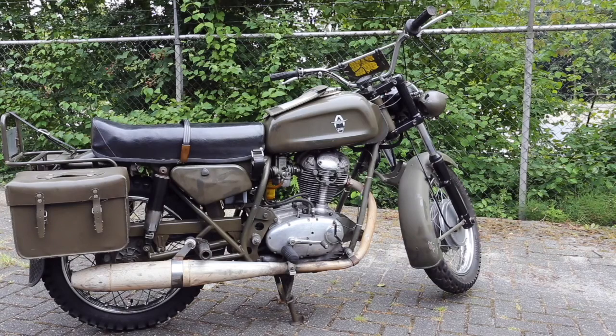Very typical of the Condor is the cam — it's a very mild cam. One thing people do to give it more power is replace it with a scrambler cam, a green-white scrambler cam. Together with the exhaust upgrade and the cam, it will up the power from about 16 or 17 brake horsepower up to about 19 or 20. I've had quite a few of these bikes, and one thing everybody wants is a reliable top speed — if you happen to be on a highway, you need at least 100 kilometres an hour, and in original trim that's not always guaranteed, especially with a headwind.